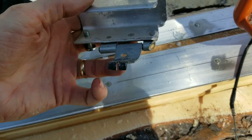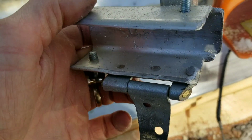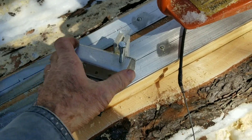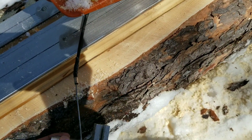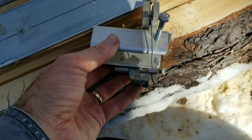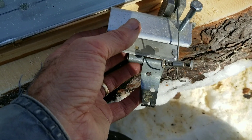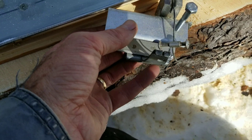The actual throttle control is just a hinge which is steel, so I had to rivet it — it's just riveted on to the side. The cable goes through the hole and through the slot, and then the lock at the end with two screws to hold the cable still just locks into this, slides into that slot and curve, and holds it. As you squeeze it, it's wrapping up the throttle.